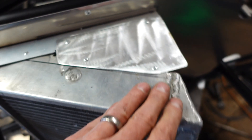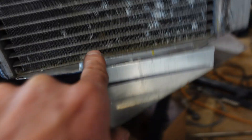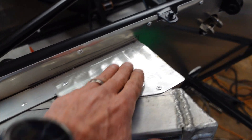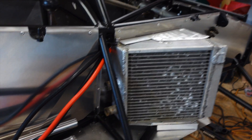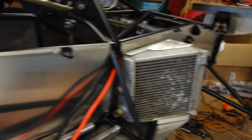I've done the first side just to have a go and see how it looks. I've got a little bit of aluminium box section, riveted the radiator onto it, and made a small L-shaped aluminium plate on top — smoothed it off and it's secure. The plan is for air to come in behind the front wheel, filter through the radiator, and I've still got to work out how to vent the back of the side pod. The pipes will run alongside to the engine compartment.